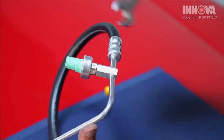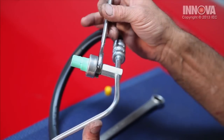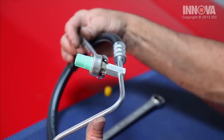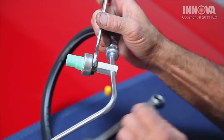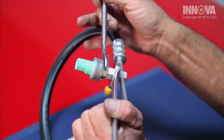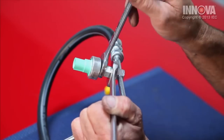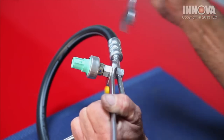What we want to do is use a thin wrench on our top, where we can actually remove the power steering switch easily. We want to secure our bottom hose so we can hold both and turn this out easily. So let's go ahead and get started.